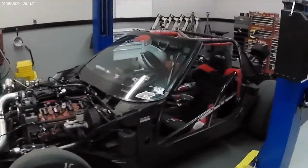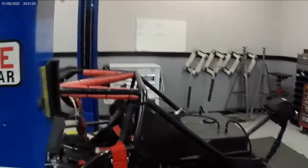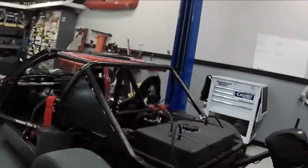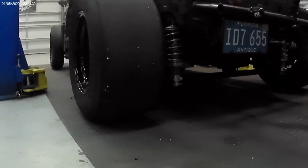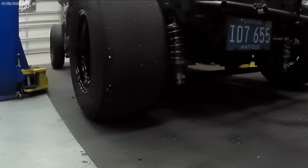So went over and did a solid axle swap in the rear using an 8.8 out of an '03 Mustang GT. And yes, believe it or not, it is standard width.